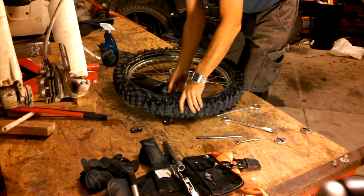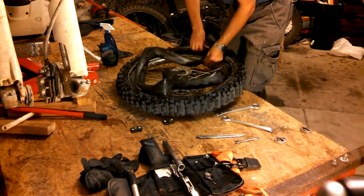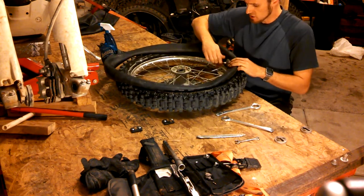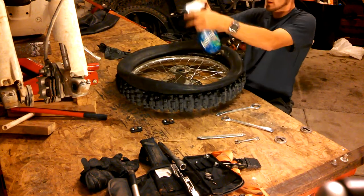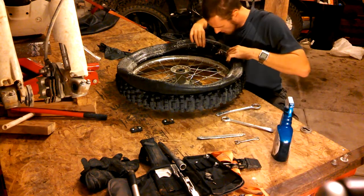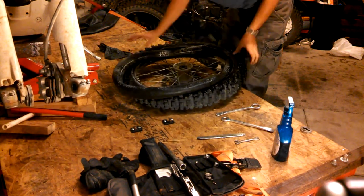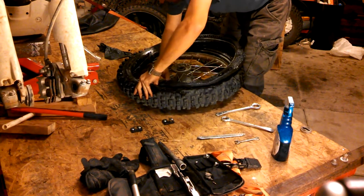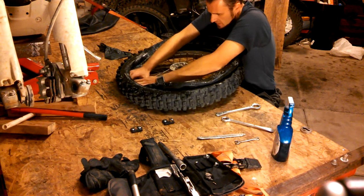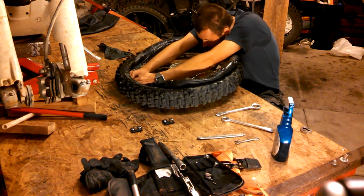Make sure you don't break your valve when pulling the tube out. I'm going to keep the old tube as a backup — make sure you don't break it completely. This is my new tube, which I recently fixed. I always like to get it nice and slippery so I can work with it — some people like to put air in it first, I don't. Valve goes first — always. I'm going to lift the tire, put the valve in, and work opposite from me so I can put my fingers aside and grab that valve. If you have a valve wire tool it makes it a lot easier, but it's not mandatory.